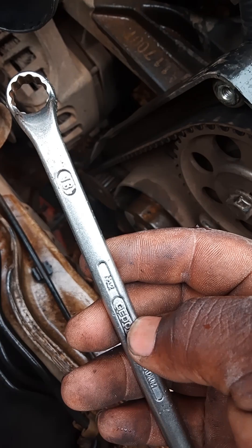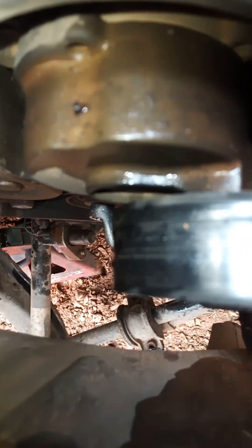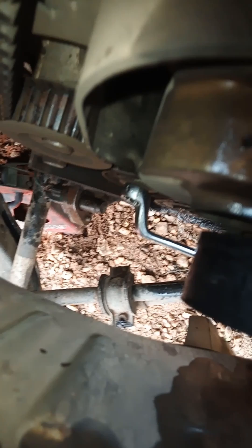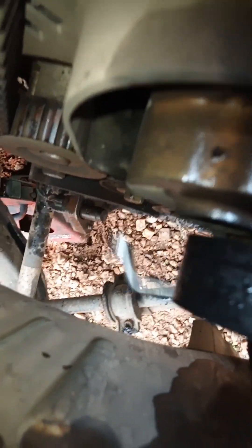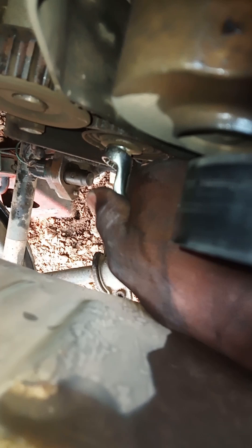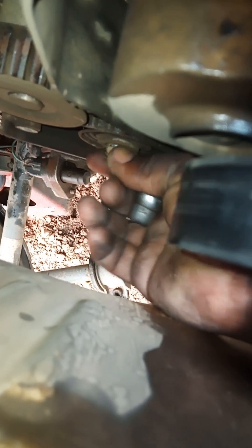Because this one is broken there, as I showed you. Now it's time to loosen it - you must have your 13mm in the ratchet. What I'm doing now is loosening the tension on the cam belt tensioner.